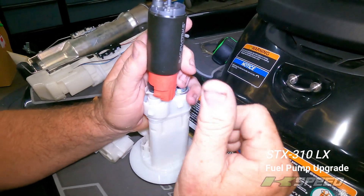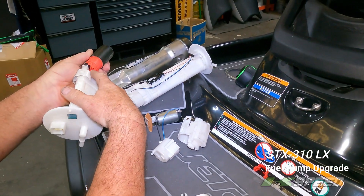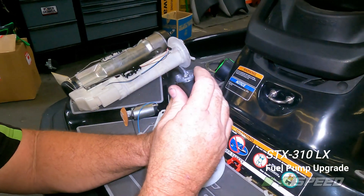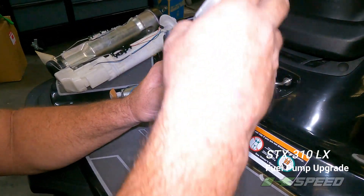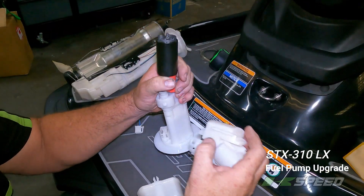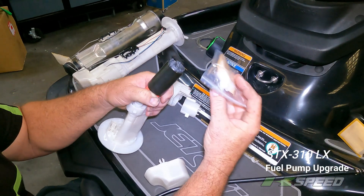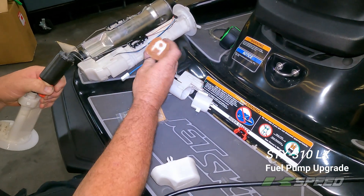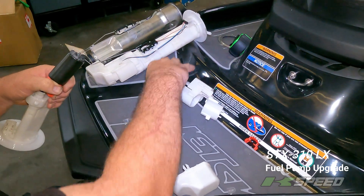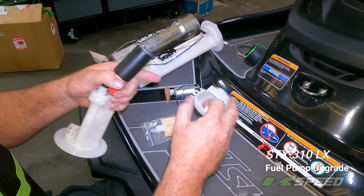With that cut off, I was able to utilize the factory wiring straight onto those terminals. With the honed-out complete housing then slipped over and all clipped into place very, very well. I utilized a flat filter rather than the tiny little filter that comes with the factory pump — I was never going to use that, that's rubbish.